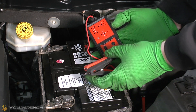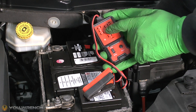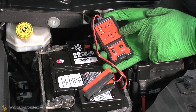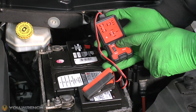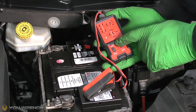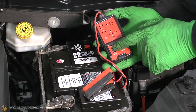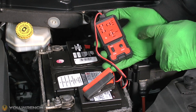For testing your relays you are going to need a 12-volt power source, and the easiest way to get that is simply to attach the unit onto your car battery. You can see here we've got three different setups for testing the three most common types of relay you'll find in your vehicle. Down here you've got a switch where you can select between four-pin and five-pin, so check your relay and make sure that is set to the correct setting.